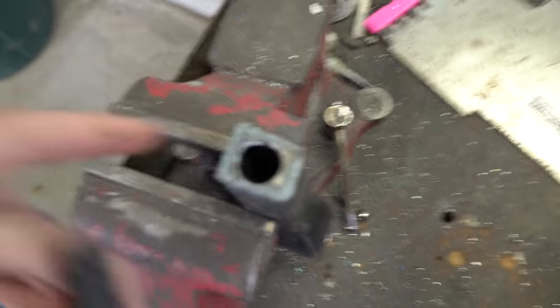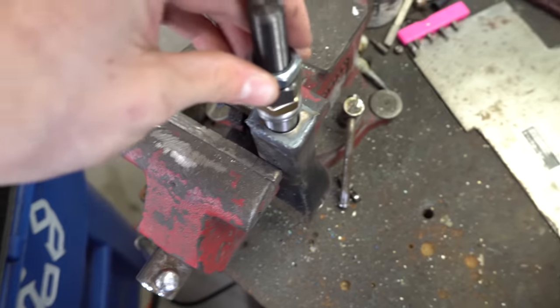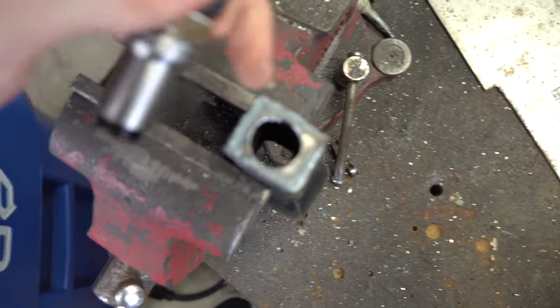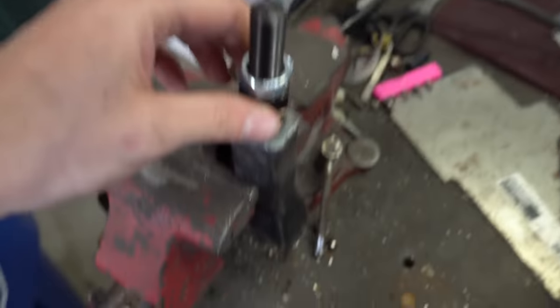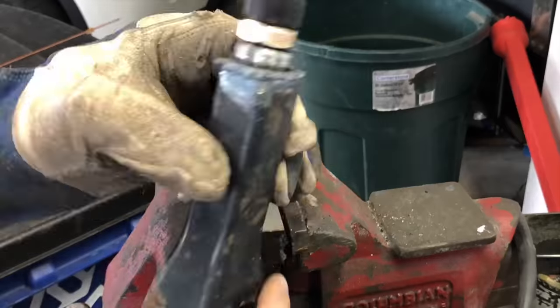I got this whole drill with the step bit in. The reason I only used 16 gauge metal is because that's the thickness of the stock arm anyway, but also you basically only touch on the edges when you're welding this piece. This drops right down into here - it's basically touching the corner on each side. I didn't get it perfectly centered so this side is a little further than the other side, but it doesn't really matter because we have this whole thread system. I'm going to weld around this edge, then repeat the process for the other side and we'll have a fully adjustable camber arm.